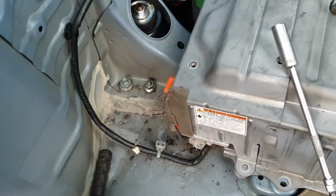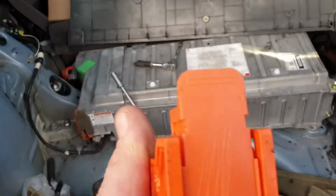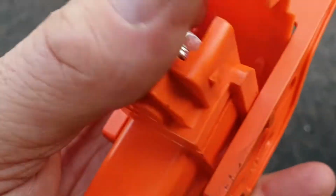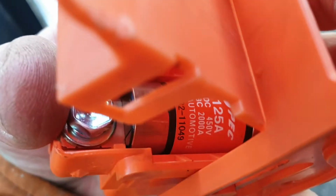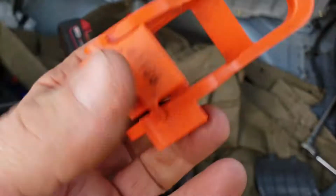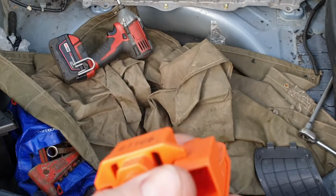But I just thought, as we're here, remember also your safety cartridge here. So you pull that and unfold it and then it comes out and it looks like that one. Now I also changed that one. That was the one that was running in there, and there is a big fusible link in there, if I can pull the cap off, which I can't. Yeah, inside there you've got another fusible link. So that could be a fault. Ah, there you go. See the big link in there, big fuse? So, 120 amp, Jesus. 125 amp. So, it could have been that, because it did seem to take some of the lights out, but then they came on, and she still wouldn't select ready.